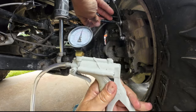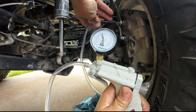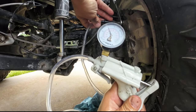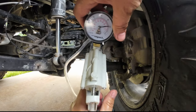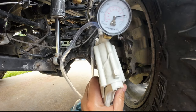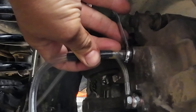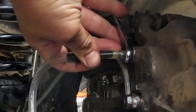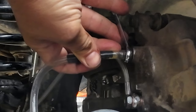And it beats having to go up and down doing press-hold, press-hold, or having the hose sitting in some brake fluid. You can turn the gauge wherever you want it to be, especially when you're trying to film and work under a car like this — it's always interesting. We're sucking fluid through it now, which means all the air is sucked out of it as well.